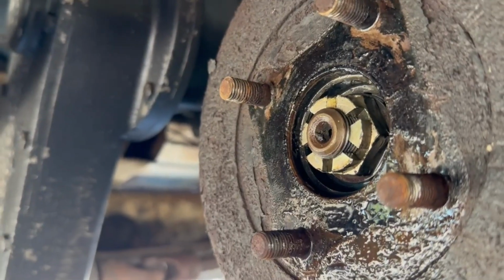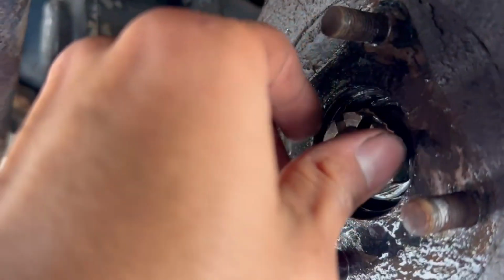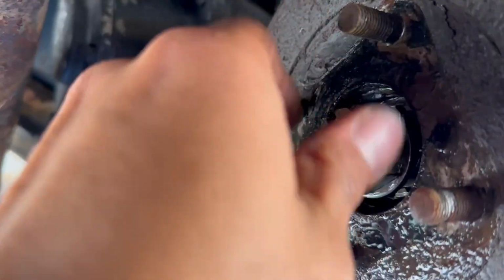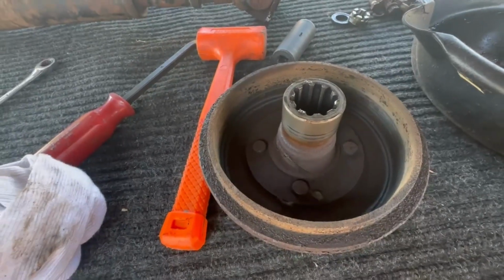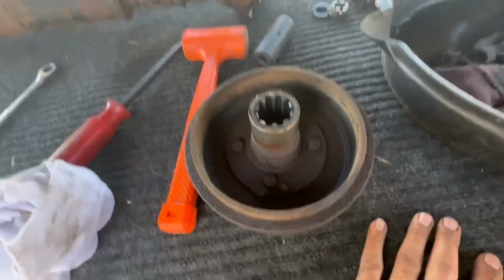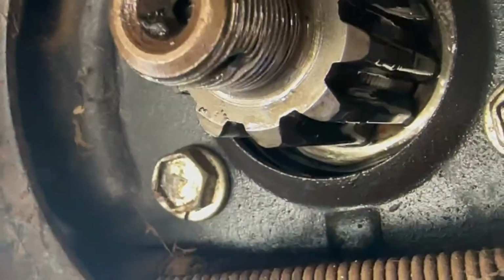So once you have the drive shaft out, you're gonna wanna take this nut off, although for whatever reason mine was loose, so luckily I have the factory service manual, and I will take a look later and see what the proper torque spec is, because I don't think finger tight is the correct spec. Okay, so after you loosen that nut and pull the washer off, the parking brake drum just simply slides out like so. The seal I'll be replacing rides along there.